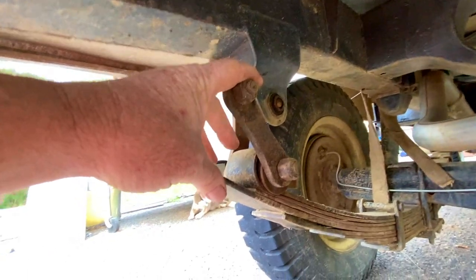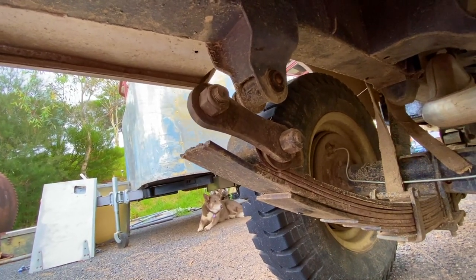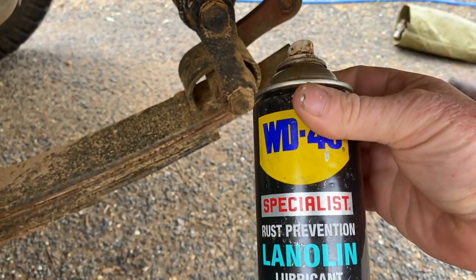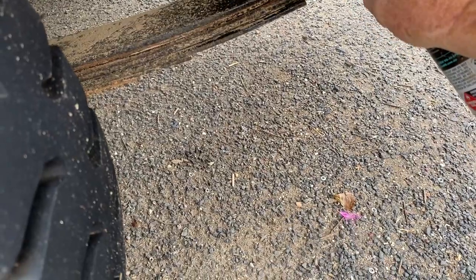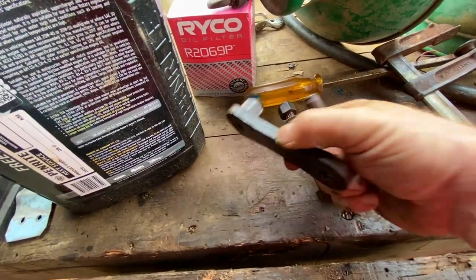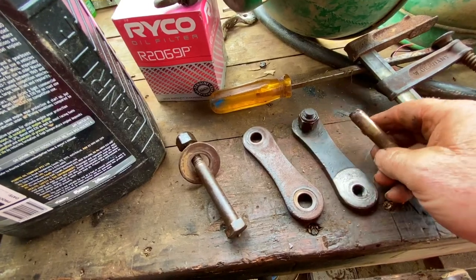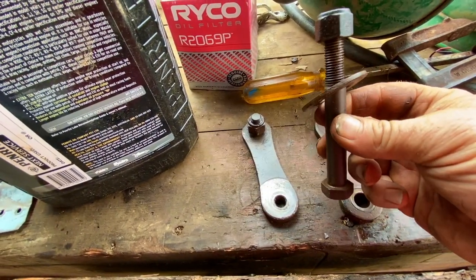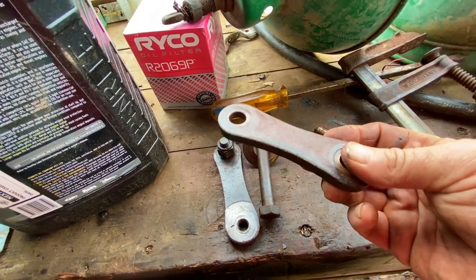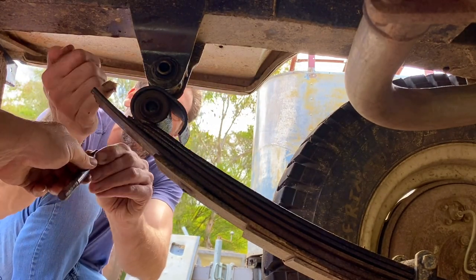While we were crawling around underneath, we realized this has snapped off, so that's the first little job — knock that out and put a new one in. First things first, a word from our not-sponsor WD-40 — we need to give this a bit of a spray. There's the culprit — it snapped off and was solidly rusted in, but we used enough bad language and WD-40 and managed to get it out. I've just got to duck into town and get some bolts so we can get the swingarm back on. Just grease up the hole and bang it through.